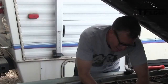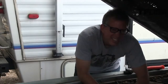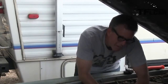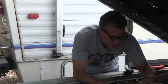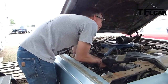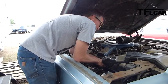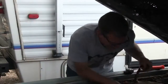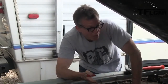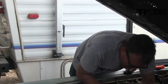So really the worst case scenario is that by not changing the oil, we introduced some kind of sludgy old oil into an engine that is incredibly understressed anyway. It's really pretty harmless. The damage was either done long before we touched it, or it's fine, and we're not doing any harm. So some of it was laziness, but it's a cost-benefit analysis, and I'm not that fussed about it. Now that said, when we get it all warmed up after driving it, the oil should go in. The car should get a full service. Yep. But for the time being, for driving it, it's understressed.